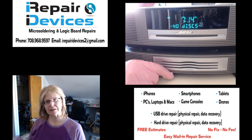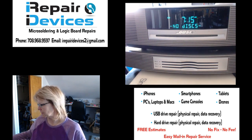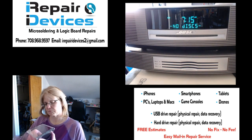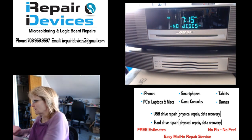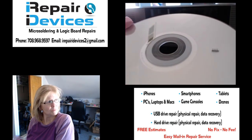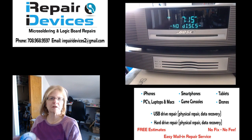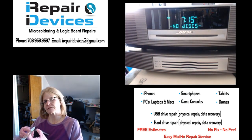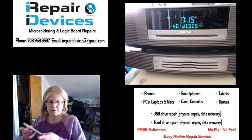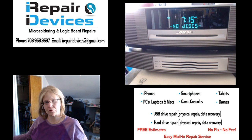So after they left, I went ahead and did the cleaning process and it doesn't take much. All it is is just a CD lens cleaning kit that you can buy — it looks like a regular CD, but when you flip it over, there's a little brush right there with four bristles. What they do is just spin inside and lightly clean off the lens for dirt and debris. This doesn't last long, maybe about 20 seconds, so I like to run it through three or four times just to make sure it kicks everything off.